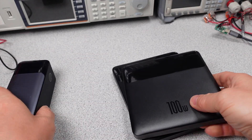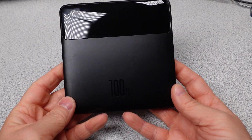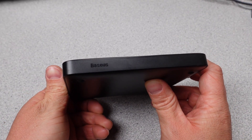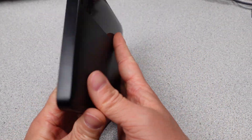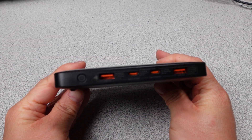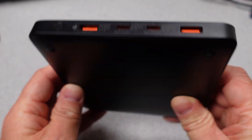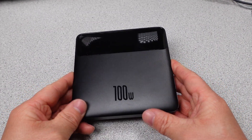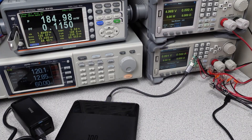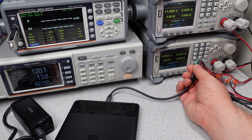The power bank has four USB ports for output or discharging, and two shared ports for input or charging. The USB-A port is a Qualcomm QC, or Quick Charge, capable port with up to 12 volts and 2.5 amps output — this can do 30 watts. The USB-A ports will drop to 5 volts only with the USB-C port being used. The USB-C ports also change modes depending on what other devices are plugged in, usually a power limit. The USB-C port uses the more modern and much more popular power delivery output, which is not bad and in line with most modern devices.